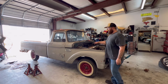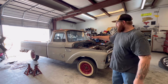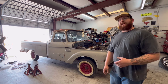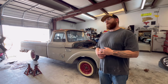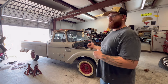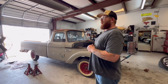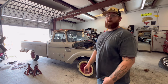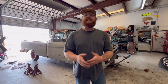Right now I just set the 390 back in here and the front clip is just sitting back on the truck so that way I can get the front end to sit back down with the weight of an engine and see ballpark how it's going to look. That engine, with cast iron heads, cast iron block, full of oil, most likely full of water, cast iron intake — how that engine sits should be comparable to the weight of the engine and transmission we're going to be putting into this vehicle. I'm putting a TDI motor in it. I'm putting the motor out of my Jetta that I daily drive into this truck.